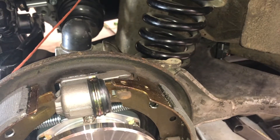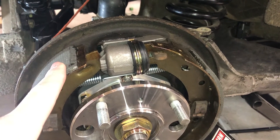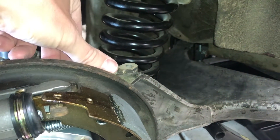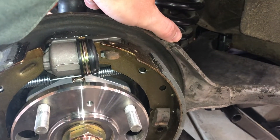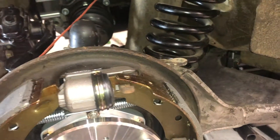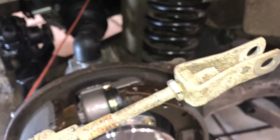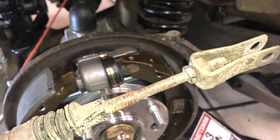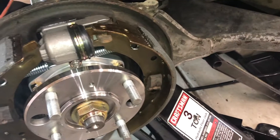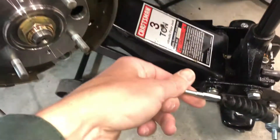One more issue: I went to put the drums on and I could not get them on. It took me forever to figure out why — I thought maybe the machining was off or I had bad parts. Then I realized the original handbrake cable was too tight, pulling on the forward shoe and pushing it forward. As soon as I released the handbrake, the drum fit on fine. I tried to adjust the original handbrake cable but the threads are all gooed up and nasty — I could only get about one and a half turns on the nut before it just twisted the whole assembly. Looks like undercoating or something stuck to it, so I ordered new handbrake cables from Moss.